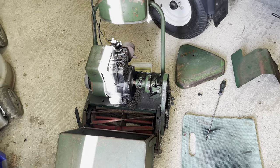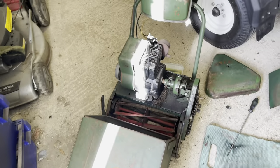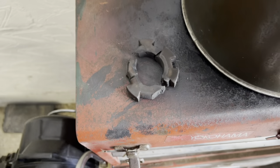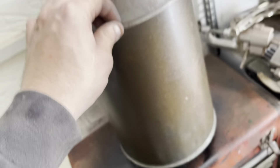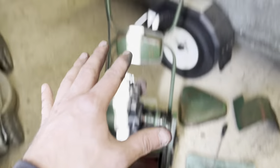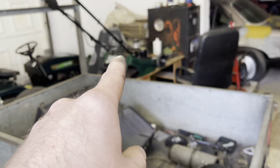I think that was a bargain. I found that piece - five pounds on eBay. The tap has a bit of cork in it, so I'm wondering if putting petrol in it might absorb into the cork and expand and stop the leaking. That was the first time this started up in a very, very long time. So next thing is to get another one of those rubber pieces. Originally there were six bits in it. I'm going to order one on eBay. I'm going to put all this back together again - it might be a couple of weeks before we have a proper look at it, because I do want to get this other lawnmower finished first for my friend.